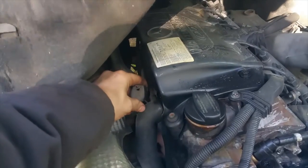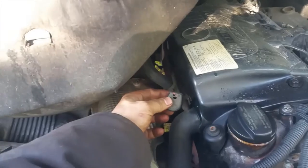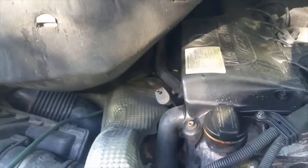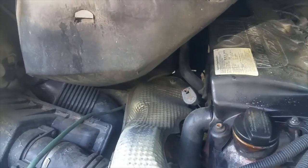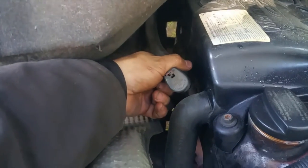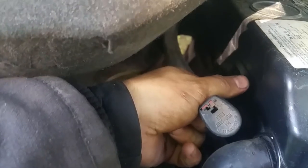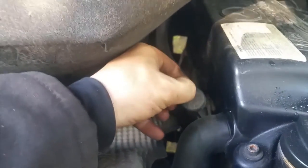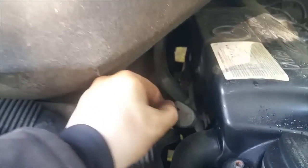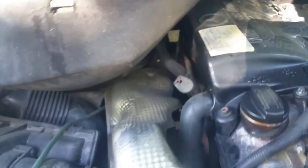What I wanted to show you is this oil fill plug - as you can see it's not coming out right now, it's really stuck. Some of you might think only the dealer could get to it, but it's being held in by this little red piece. You can try to stick something underneath - I'm sticking my nail underneath and it's already moving. You're gonna need a screwdriver or something thin to just push it out.